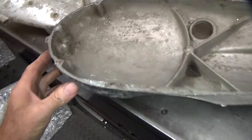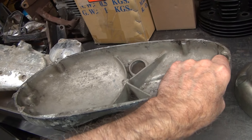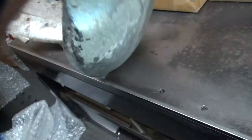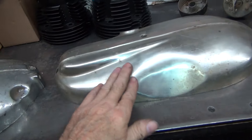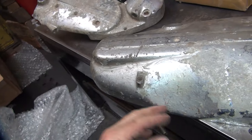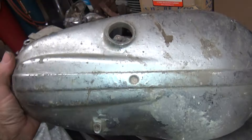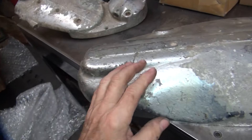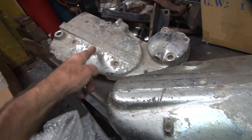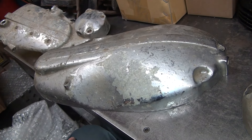This one over here has been chromed. Looks like crap. And my guess is it was mounted onto a Sportster — you can see how it was hitting and the chain got loose, it was hitting on it a little bit. It's not broken though, which is nice. It has the same everything else just like the other one. The correct Sportster one would have 'Sportster' written across the whole face here — it was more rounded on both sides with 'Sportster' in script all the way across. So my guess is they had this on the Sportster instead of the nice one, and it came off the same bike. They would be all interchangeable because it takes the same gasket, the same everything.